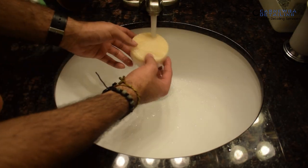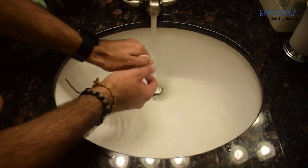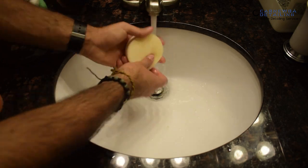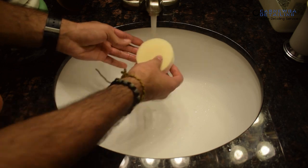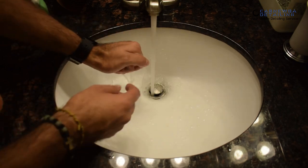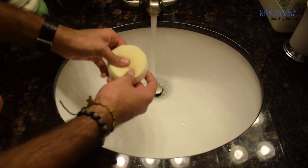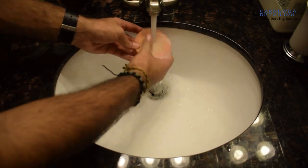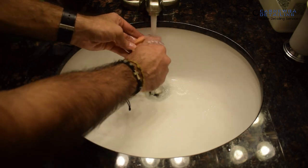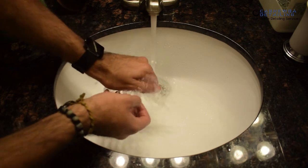Moving on to the 3-inch pads, this specific one I use for headlight restoration — actually on the same vehicle I showcased in my previous video, which was a Nissan 350Z. I'll put that link in the description. Now it is a white pad, but as you can see the top has been yellowed, and that's just the oxidation from the headlights that has stained the pad. After cleaning it out, it doesn't mean the pad is still dirty — it just means the pad has been stained, so it's not a big deal. You can use it again for future headlight restorations. I usually keep pads used on plastic, headlights, or glass and utilize them just for that purpose only — I don't cross-contaminate. But you are perfectly fine to use it on paint again if you'd like; I just like to organize my pads and microfiber towels that way.